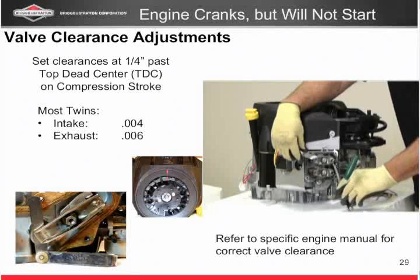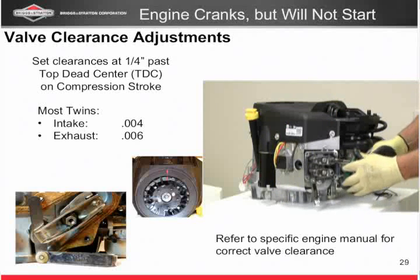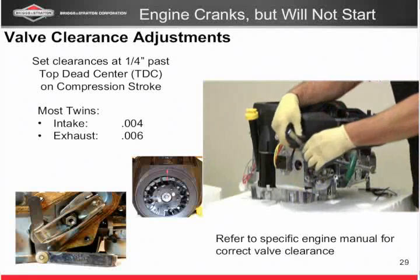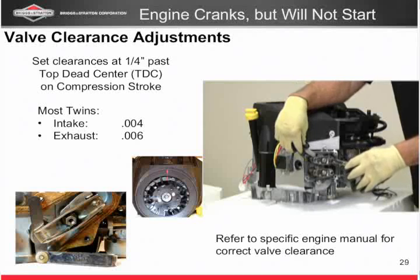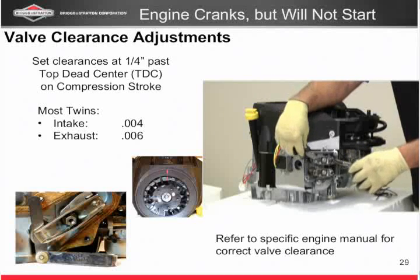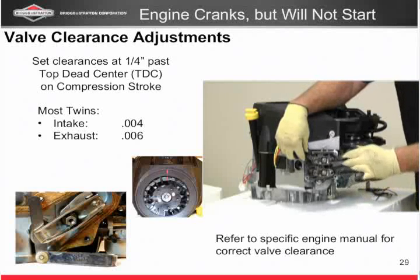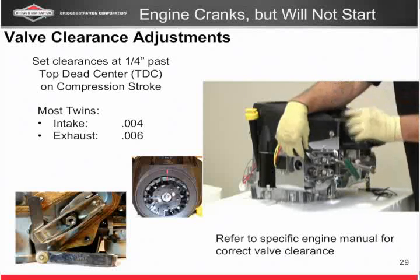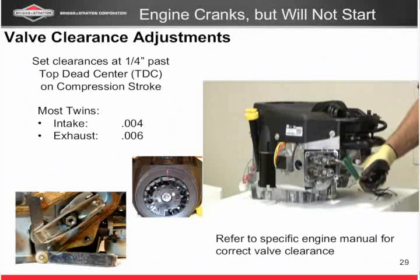Once I get a snug feel, I go back and hold the Allen wrench while I tighten my lock nut — I'm holding this so that the screw does not turn in with the lock nut. Then I go back and verify this is still a snug fit and not a tight fit. If I could not get the feeler gauge back in without really shoving it, I've got to readjust that valve a little bit — turn the adjuster out just a little bit, maybe an eighth of a turn, just to give it a little freedom so that when I tighten the lock nut I'm not changing the adjustment. It takes a little trial and error, but you get the hang of it after a while.